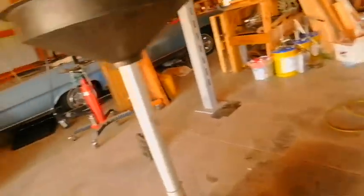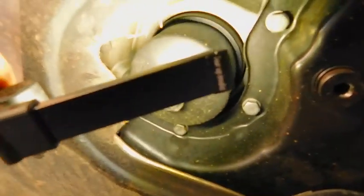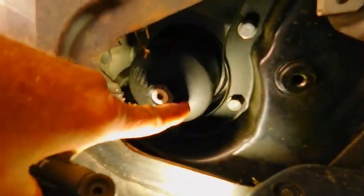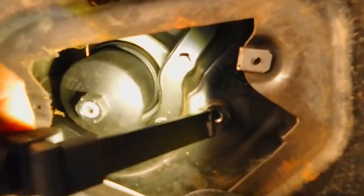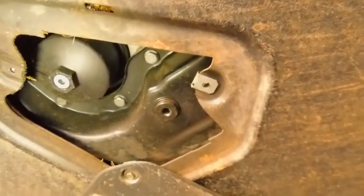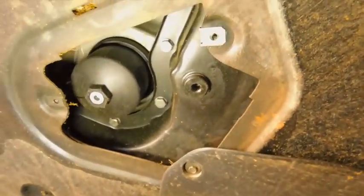Now, it'll also tell you too, I didn't show you this. It'll tell you 25 Newton meters of force to tighten it on. The drain plug is right here, 10 Newton meters. And I forget what's over there. I think it just is the brand. So this is 25, and that's 10 on this particular. I think this is a 4.8 V8, and it's smooth too. Let me tell you, I love this car.